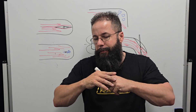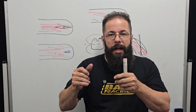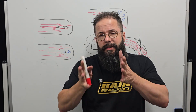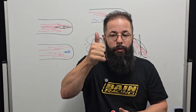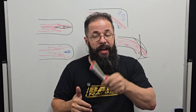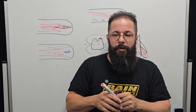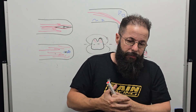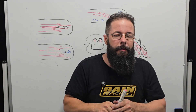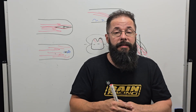Hopefully that helps. This is where we lose port efficiency, so with any porting we've got to be really careful. It's like people who put bigger valves in and say 'oh look, we made eight CFM with the 2.1 instead of the 2.02' — but you've got to take into account the ratios: how big a throat you put in, what sort of port volume it's got now. Port fins are great because they take volume out of the port, improve streamlining, reduce the drag coefficient, and improve port efficiency. I thought I'd do a really short one on this because I have covered it before, but we've had questions from new folks about this exact thing. Anyone that knows me knows I try and keep them where they're beneficial. If you've got a tiny little bump — like in a Ford XR6 Turbo head or even some of the smaller guides in the 2JZs — sometimes you can just knock them out. It really just depends; we're only talking about half a CC maybe. Anyway, hopefully that helps — cheers guys.